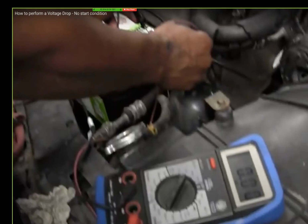Okay? Davis. Yes. So you're saying outer poles, you're referring to the battery clamp, correct? Yes. The outer poles is the clamp, the cable. I mean, the outer clamp, which goes to the cable. The clamp connected to the battery post on the positive side. Yes, exactly. So remember, that's the positive side. So both of them should be 12 volts or 12.6. So if the center is 12.6 and the outer is 12.6, the difference should be 0. Remember, the meter shows the difference between the two leads.